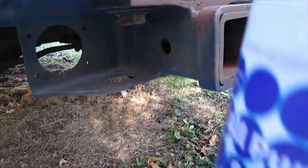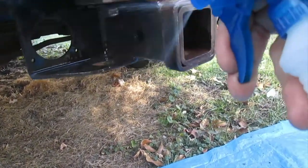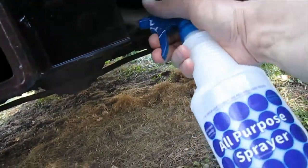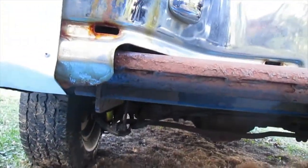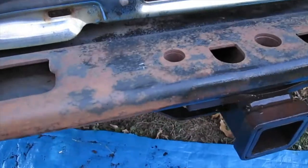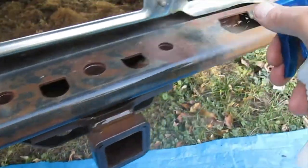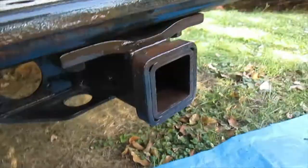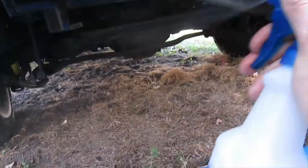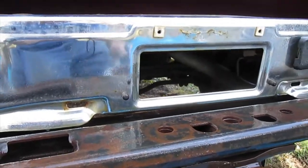After wire brushing, I'm going to take some soap in a squirter bottle — the directions on the paint can say to do this. I'll go over all surfaces up here; this area actually gets covered by a piece of plastic so I won't go crazy there, but the main thing is the hitch, which is visible. I'll go over that with the soapy water and let it sit for five minutes to do its job.